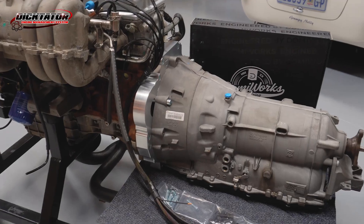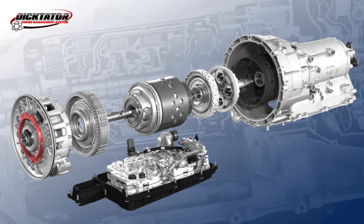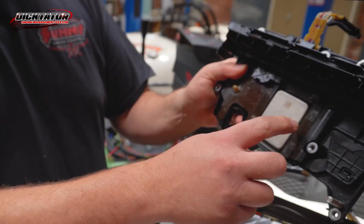What do these boxes go for? The average going rate for a good gearbox is about 30,000 rand, and it's still in good condition. It doesn't work like a normal automatic gearbox — it's quite sophisticated and involved. The actual physical ECU sits inside the mechatronics, which makes the solenoids and everything work. The problem is this thing has a physical ECU inside the gearbox.